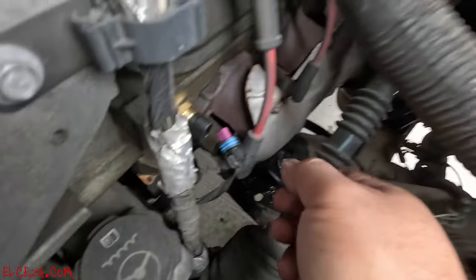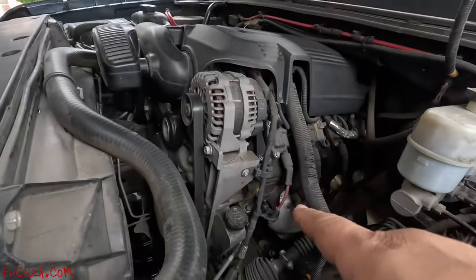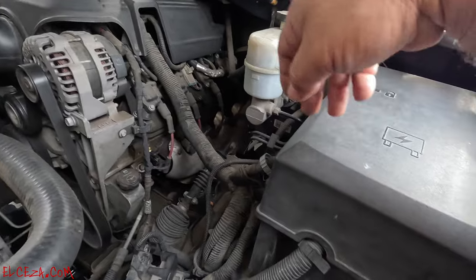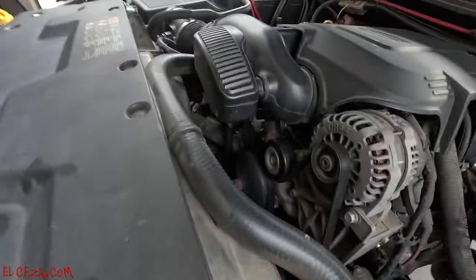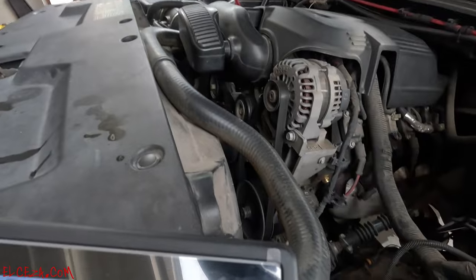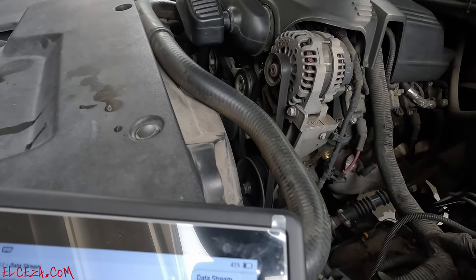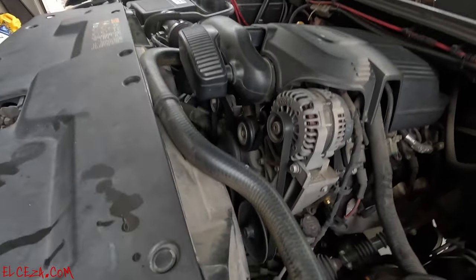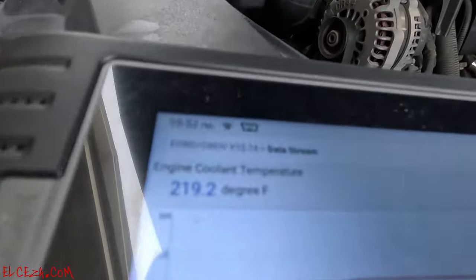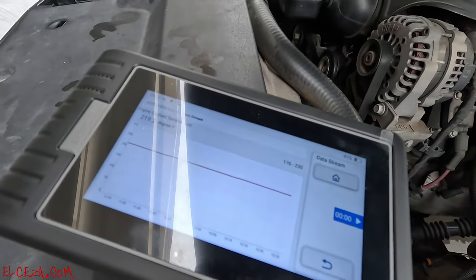Make sure you connect the sensor back in and let it click. Let's turn it on and try it out. I replaced the sensor and it didn't solve the issue. I thought it was the relays — those were all good. So the next thing I did was replace the thermostat. I put an OEM thermostat back in; apparently the customer had replaced it with an AutoZone one, and that was causing the problem. The problem is now fixed — temperature's climbing and the fans kick in at around 224–225.